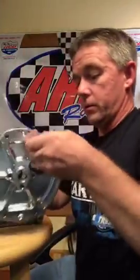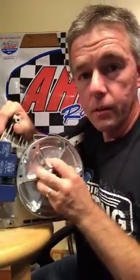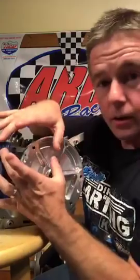It talks about and shows you shooting the flywheel with a timing light. There's two ways you can shoot with a timing light. You shoot the degree wheel to see where the actual degree is, or you shine it directly at the flywheel, at the coil. Well, hang on, I got a flywheel on here. You'll shine it directly in this area right here.